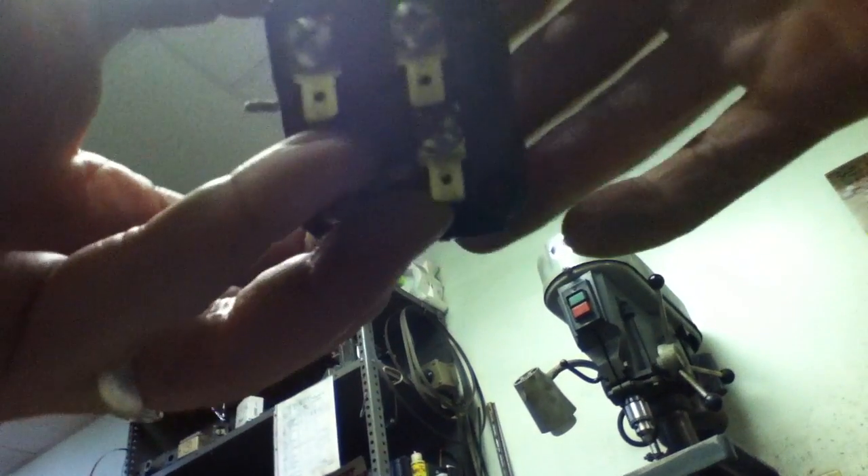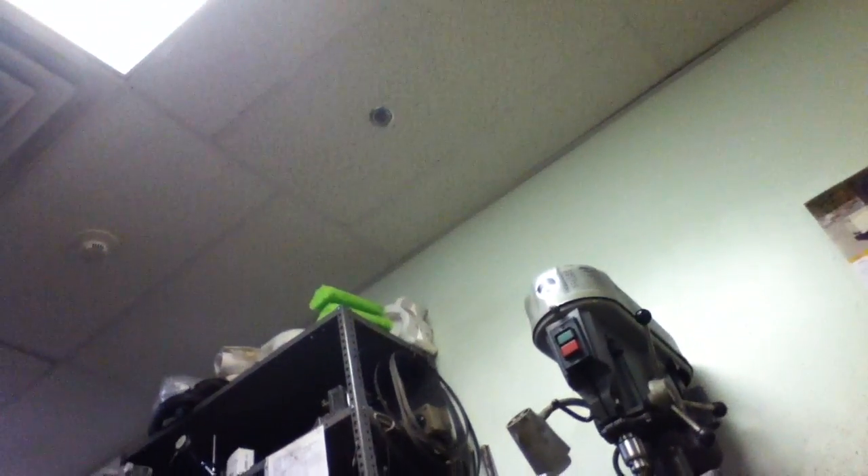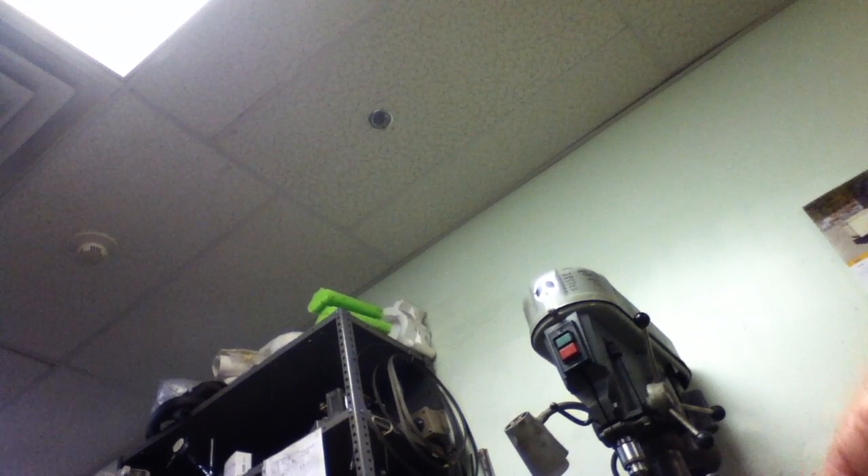I just put that back lip in. Now this piece is going to fight me with the spring. Take my needle nose, bend it away while holding that end down with that small lip. Bend it away and it will kind of snap right down in place. I have all the spring pressure off the adjustment screw — I counted eight full turns out.